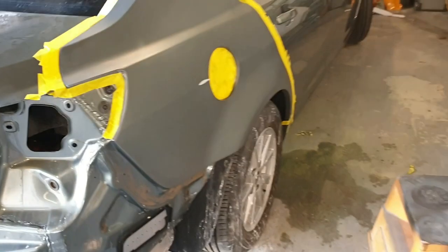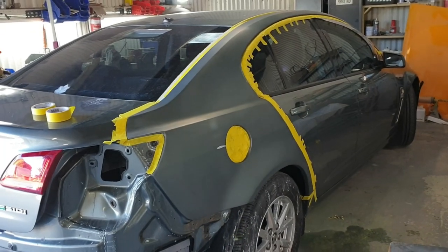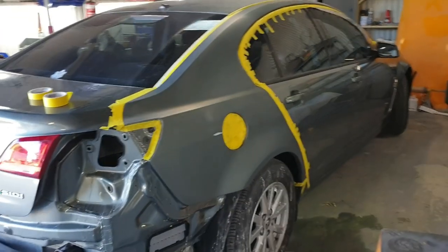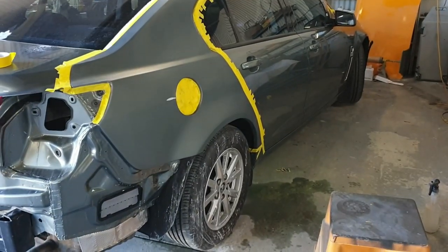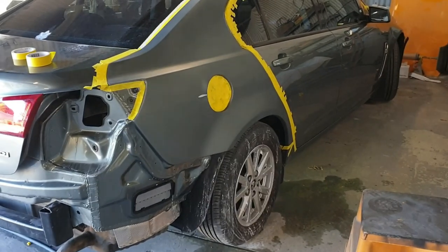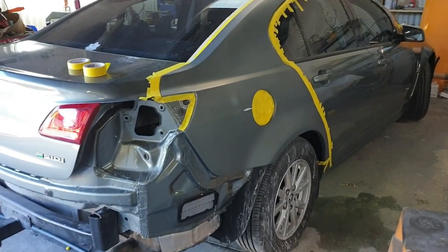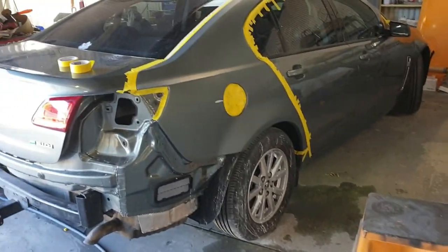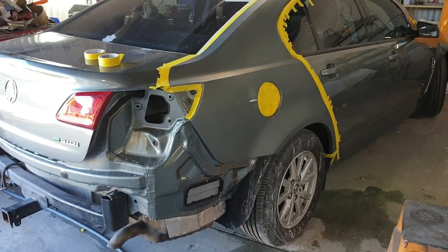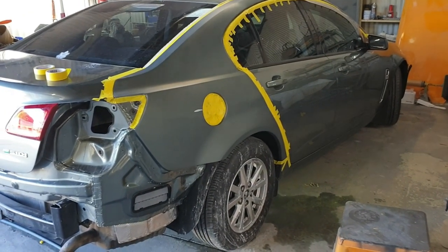Most people say why don't you blend the door and the boot lid - I'm not going to. In a crash shop they would absolutely blend the door, but I'm going to hope the color's right and send it, because we just need the car done. I don't have unlimited funds, so I just need to do the damage and carry on. In the scheme of things, that quarter panel has turned out quite not too shabby considering how crushed it was.